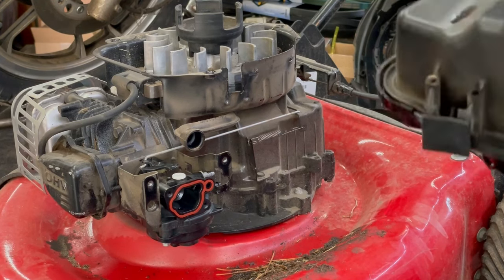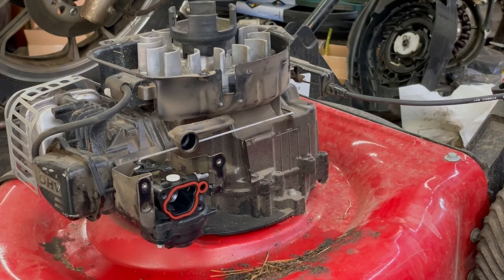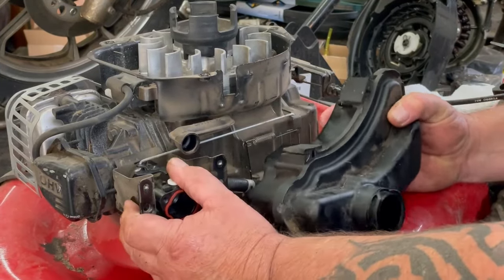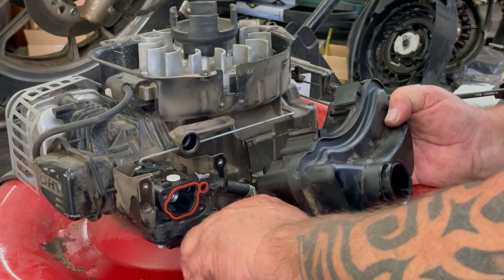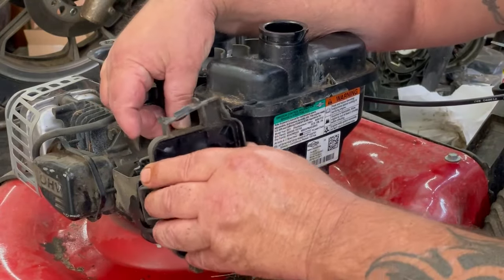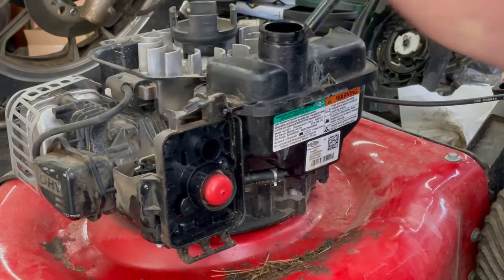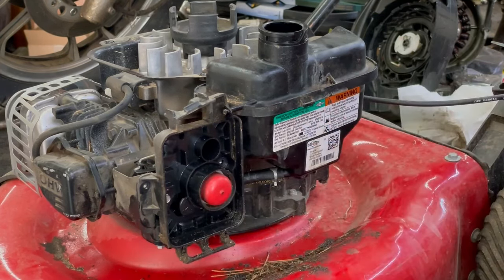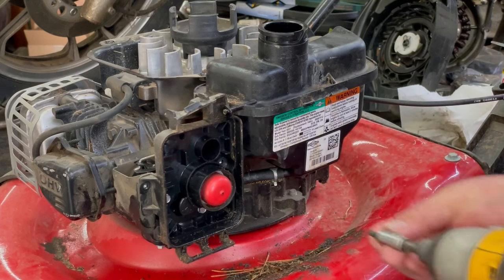There's something clicking around in there. Grab the air hose and blow this out. See if I can get that thing out that's making all that noise. A few little rocks came out of there, but there's like a piece of plastic in there. That's part of the gas cap thing, I believe. Right, here we go. Nice and clean now. But our vent tube goes on here. Pops into place there. I'm gonna put our two little 9/32 screws in. Now our two 5/16.